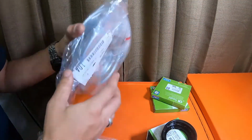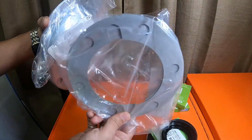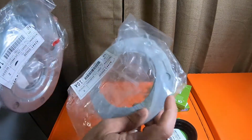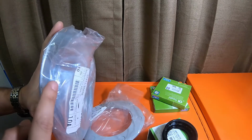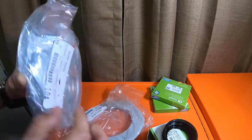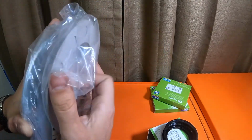So you have your studs that go through here for your rim. On the inside of this plate right here is one of these gaskets. In the Toyota manual, the actual mechanic shop manual, these are considered dampeners. So this dampener sits on this side, and then you run your studs through this way, and you have the metal plate, the studs, and then you have the actual plate that the rim sits and bolts against too, which is the hub plate. So this basically sandwiches the dampener against the other metal plate, and the studs actually keep all 3 of these items smushed together like that.